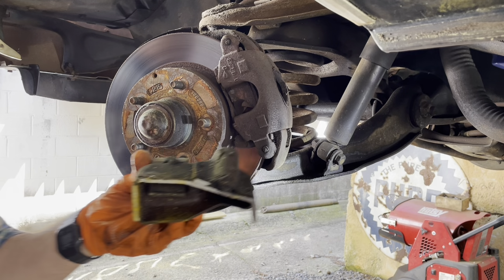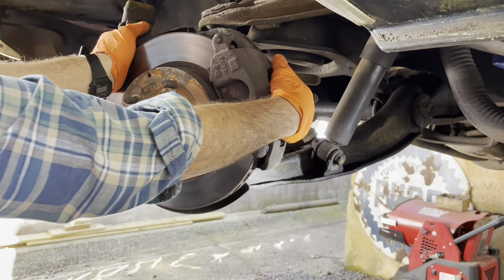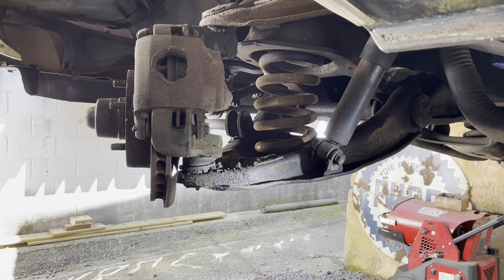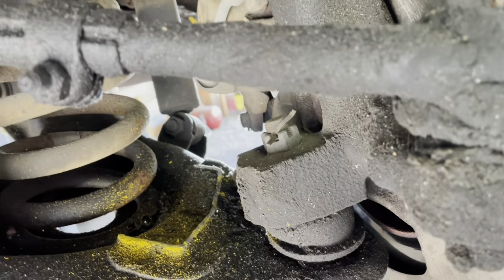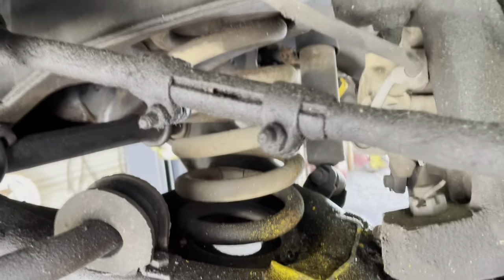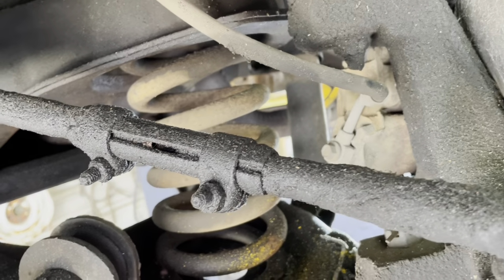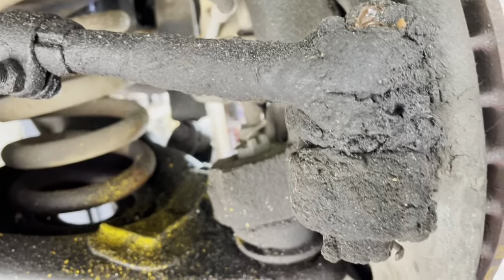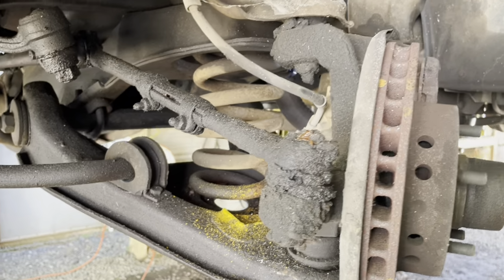So see, rid of that bump stop. That usually just takes a matter of seconds, really, if not minutes. What I'll do now is I'll move to the other side and go ahead and cut the other side loose so that part will be done. So here's what that's going to look like after you've got that bump stop cut out of there. Just remove that so you got plenty of room now. And usually cut around in 3/4 out, and that will never hit metal to metal. We've never experienced that anyway. You could put a bump stop back in there if you wanted to, something smaller, but usually that's not a problem at all.